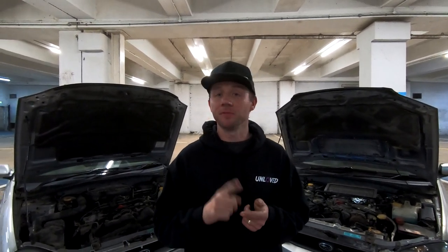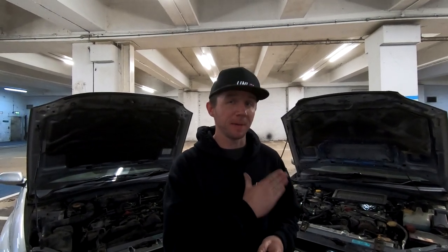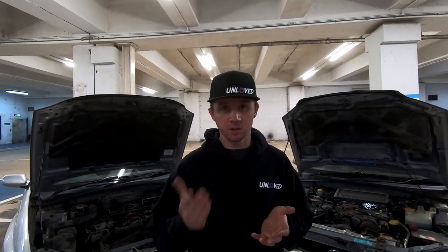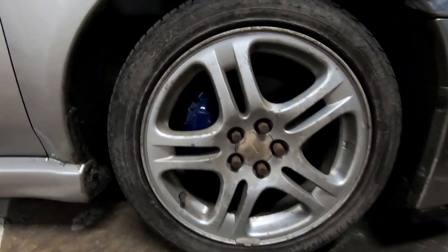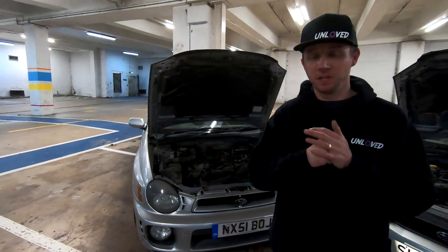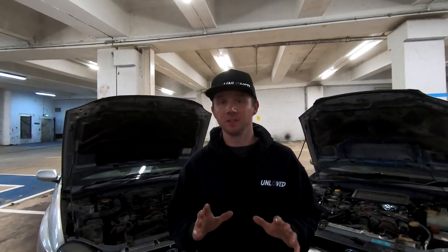Gearboxes — the gearbox in this is actually from a Forester, which matches the rear diff because that's also from a Forester. All the chassis is straightforward, it's plug and play. I've even managed to use the same shafts that came out of it to get it all put back together. Going forward, it's already got WRX suspension and WRX brakes on it, so I wasn't worried about that — but I would never do it onto standard non-turbo brakes, because it would not stop the car even at standard power.